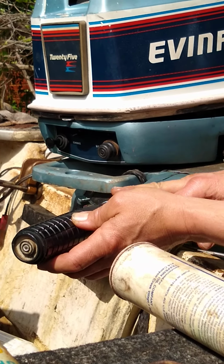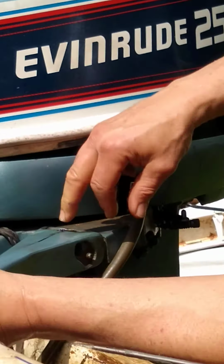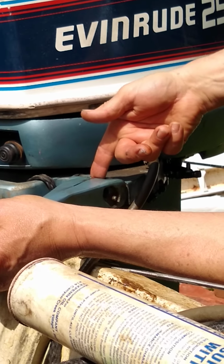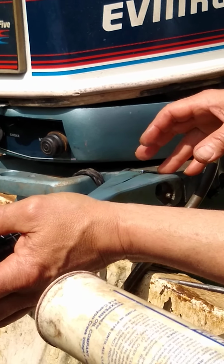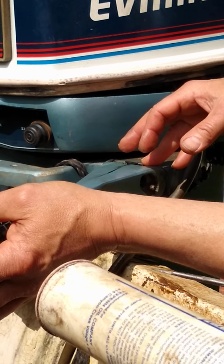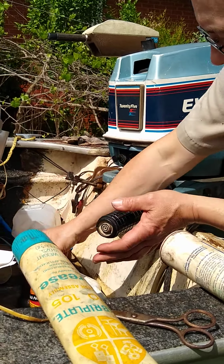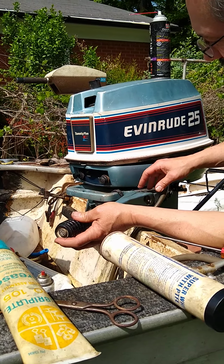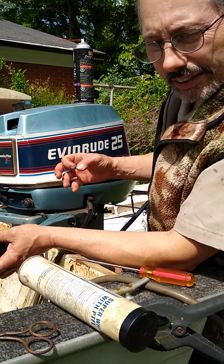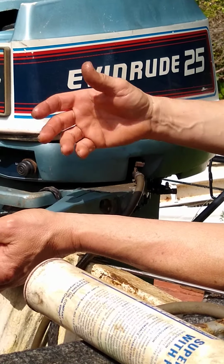It's pretty simple, but the gears are down here, and you just want to put some oil down in there, or some penetrating lube, something that will not evaporate. So you don't want to use WD-40, you want something better. I like to use a penetrating oil. I got Pennzoil here, and then I use regular motor oil in my oil can, and I lube that up to keep something to fight the friction and keep moisture away, which keeps corrosion away.